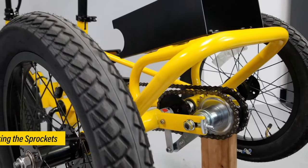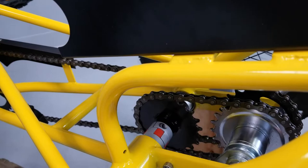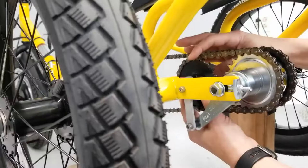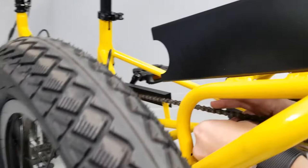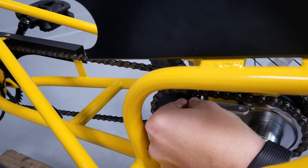There's also another thing we want to check: the sprockets. If you take your flat edge and put it on the edge of the black sprocket, you'll see that we are pretty drastically out of alignment. Find the silver bolt connected to the black sprocket and use your 5mm Allen wrench to loosen it. With the bolt loose, you should be able to move your black sprocket. Take your straight edge, put it on the surface of the black sprocket, and bring it over until it touches the face of the silver sprocket — that will put you in line.